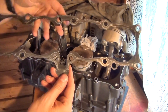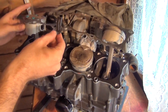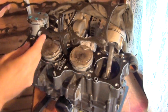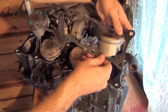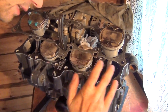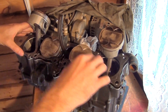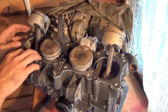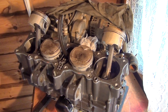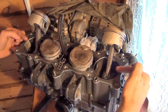This is the old base gasket — you can see there's plenty of marks and discoloration on it. I've cut out the inner portion of it so I'll be able to put it on as a shield towards the new base gasket, because from my experience installation of the cylinders is a very painful experience and usually ends up with the maiming of that base gasket. So I'm going to put this one on top of it, and during installation the new base gasket should be safe and free from damage. Once the cylinders go on, I'll lower them completely to the gasket, then cut those two ends, remove the used gasket and just slide the cylinders on.